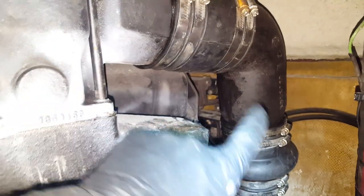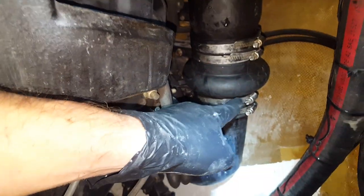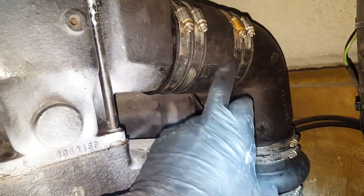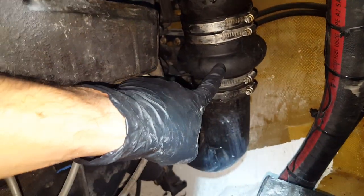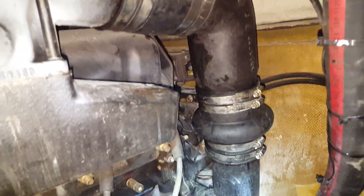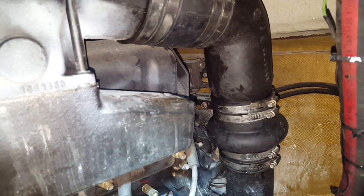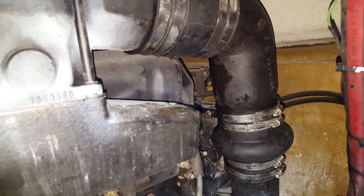If you do see any leaks, they'll happen right down here — just go under there and retighten it. That's pretty much going to do it for this video. Just repeat it for the other side, and make sure you go through and double-check all your worm clamps — I've left a few loose on accident myself and you'll know it real quick when you start it up. It's not the end of the world. Just take your time, don't over-tighten — just snug them up real good and they'll hold fine since you've doubled up on all the joints. Hope you liked the video, subscribe if you haven't, hit that like button, and leave me some comments. Have a good one everybody!